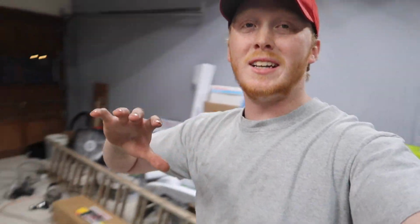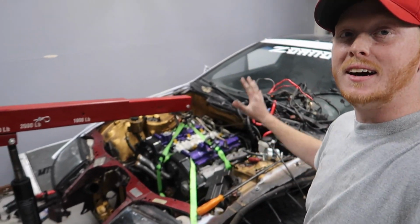All right guys, so we ended up running into a ton of problems pulling out this engine. Originally the plan was to keep the trans in the car and pull the engine out. Well, the oil pan hits on the front subframe, so in my opinion there's no way to get it out other than pulling the trans or dropping the subframe. Personally, I think pulling the trans is probably going to be easier, and it's gonna be easier when I reinstall the engine. So I'm probably gonna have to pull the trans tomorrow, and that'll be in the next video, and also the engine will be in the next video.